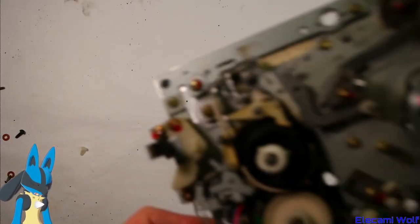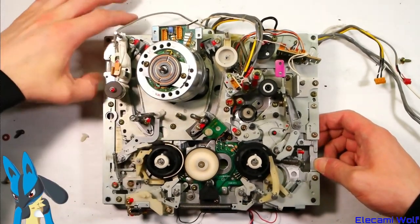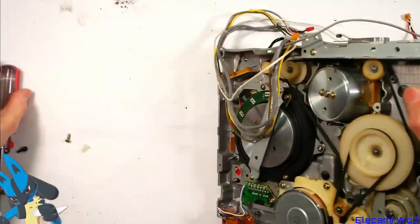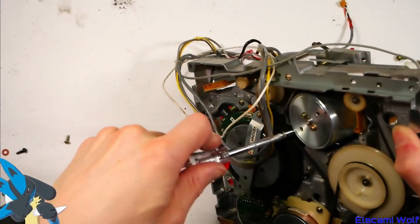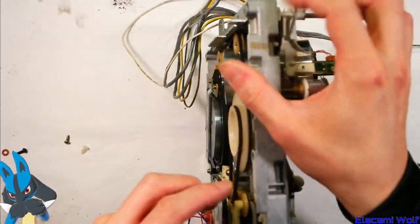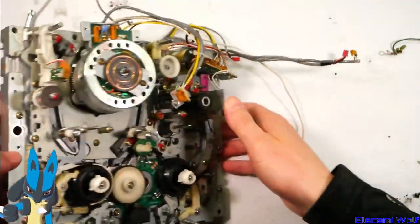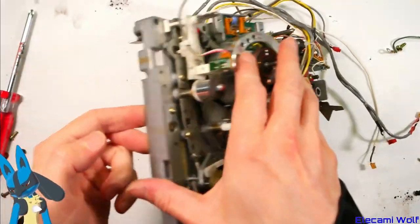Let's have a little look at the mechanical part. Normal VHS mechanics, it's just a weird head — the video head. Does that shaft go continuous all the way through? This will take the whole video head out so we can inspect it. It's one of those ones with a big motor on the bottom. I'm wondering — is this a newer machine than the one in the service manual? Probably, because the model number is higher. Did they start off with the video head signal including the audio on the bottom edge, and then realize there was a problem and improve it in this machine to bring the audio pickups to the top to get them away from the video pickups?